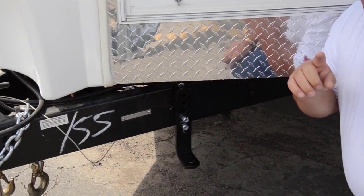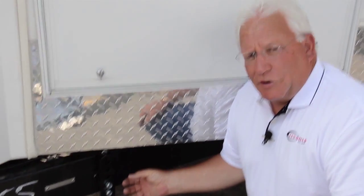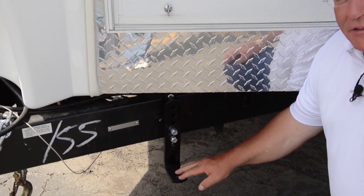The one thing you want to remember when you do the install on these brackets is to turn the brackets in the inverted position — put the studs at the bottom. This makes it a lot easier for this install and to load the bars onto this trailer.